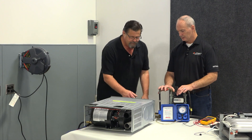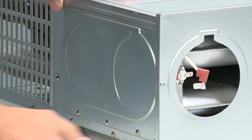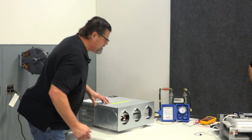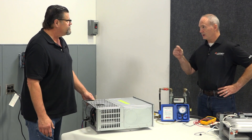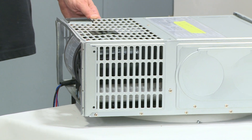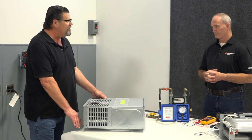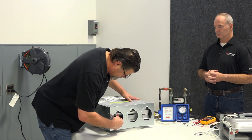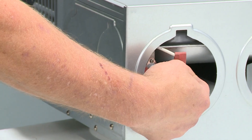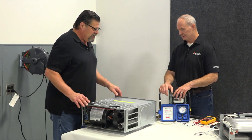Normally it takes four or five minutes, but what I'm going to do here is simply unplug the ECO so the circuit opens. You can see we have no more fire — it turned off immediately, just like that. Basically what I did is tricked it into thinking it's too hot. Now I'm going to let it cool off a little bit and then reset the ECO, just like it would cool off and reset by itself. The fan turned off — got it.